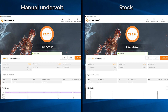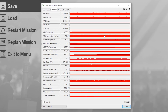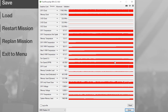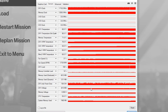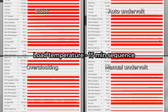Despite the lower clock speeds, the overall performance figures were just a tad lower. But as you can see here, the junction temperature was way below 100°C — even below 90°C — which is now a decent figure compared to our starting point, while the GPU edge temperature also finally came down below that magic 70°C number. Fan speeds came way down this time, around 1700–1800 RPM, which was now really acceptable noise-wise, and that's also with a manually set fan curve. Let me put everything side by side — all the different profiles and settings I've tried, their outcomes in terms of GPU temperatures, fan speeds, loudness, power consumption, and performance figures in 3DMark, so you can see for yourself what kind of difference can be achieved by playing around with Radeon 7 Wattman settings. It's nothing complicated — all you basically need is some time out of your day.